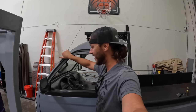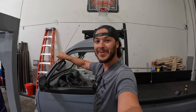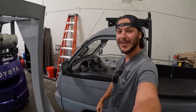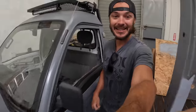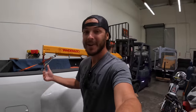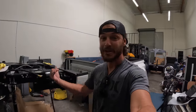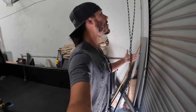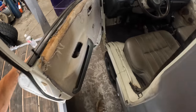The other thing is the mini truck has been running a little rough lately. Zach thinks we can get away with just changing out the spark plugs, so I think that's what we're going to try today — swap out the spark plugs and see if that helps it run a little better. It's actually been starting easier, it just seems like it's running rougher. Let's open up the shop to get some ventilation because one thing's for sure, she does run rich.